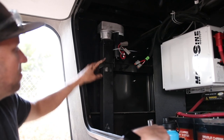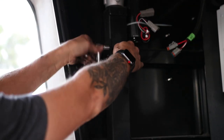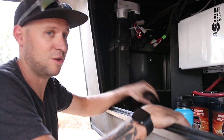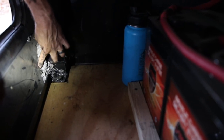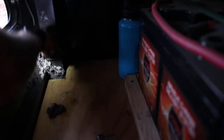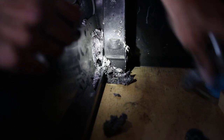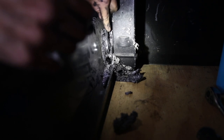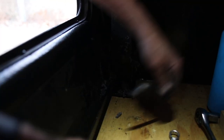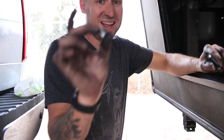This entire jack unit is held in place by just two carriage bolts. Go ahead and undo those. Save the carriage bolts because they are not included with the replacement — you will have to reuse them. One carriage bolt is surrounded by nasty foam sealant, so that's why you want a knife or scraper to clear it away. There's not enough room to get a socket in there, so you'll have to suffer through using an actual wrench. Can you believe the entire weight these jacks support is held by just two carriage bolts and a regular nut — not even a locking nut?